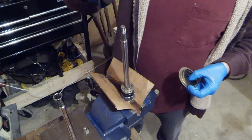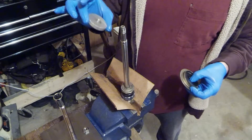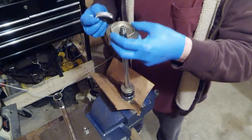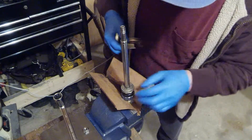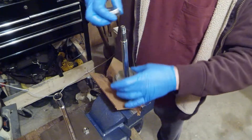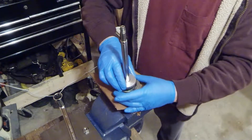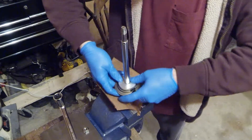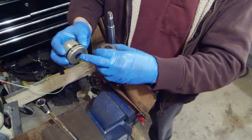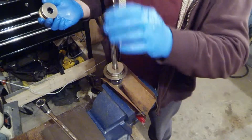I'm changing this over to be used on a different machine, so I've had to cut myself a special aluminum spacer — it wasn't quite enough. I want to make sure that I don't bottom out the plush ride system on the inside of this shock, so I'm going to put in one more washer between them and then put everything back together. After you get the new seals all put in, don't forget to lube them and don't forget your bump stop.